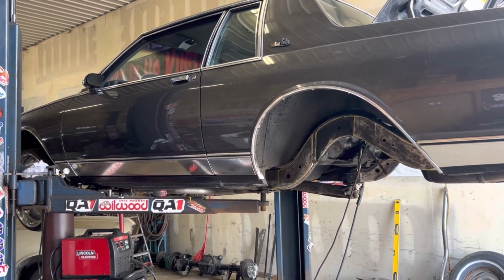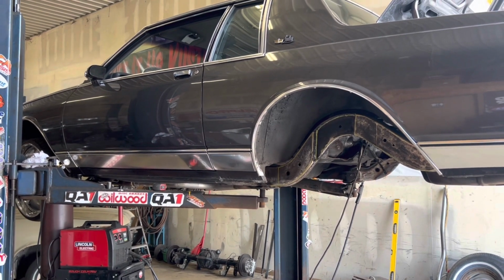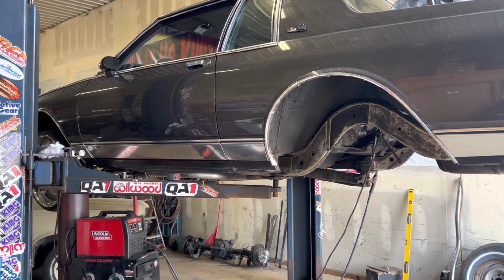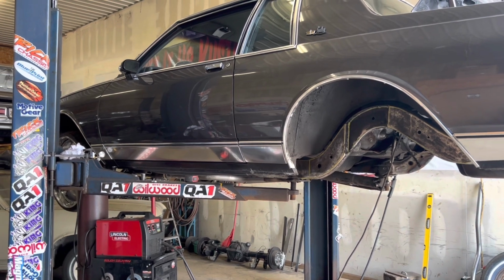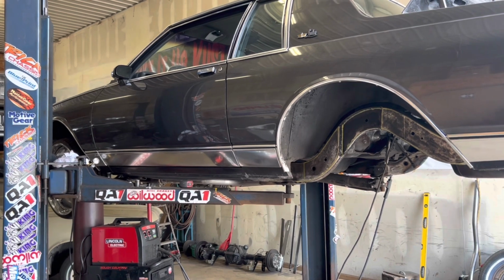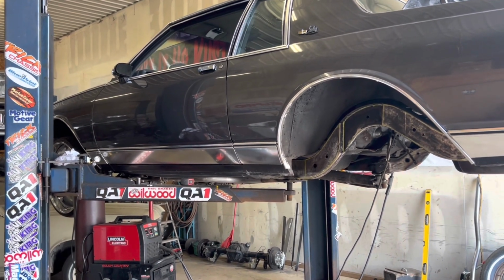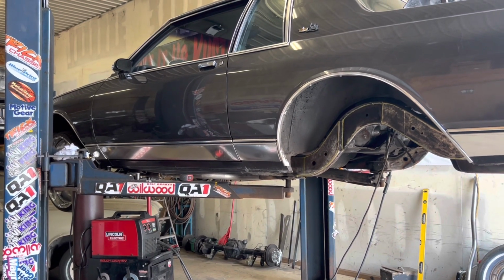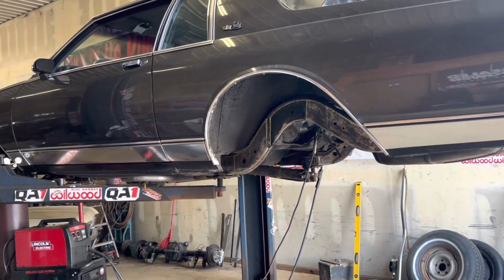And if someone's got an expensive price and you don't see where that expensive price could have possibly come from, because a car's got stock springs in it with some knuckles in it, no. Some people will want to sit there and talk shit and say that coilovers ride so rough. If you do not have the correct rate spring, yes, your car will. You can play with those knobs all you want on that coilover and you're not going to get it to ride right.